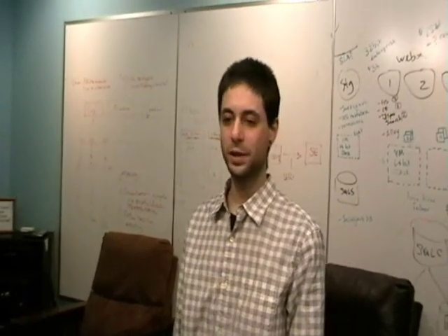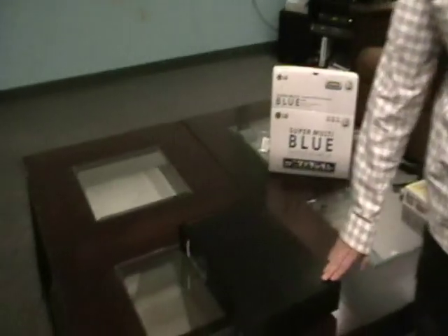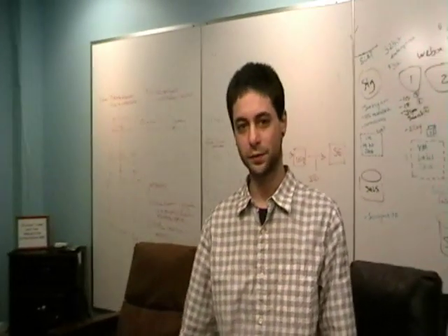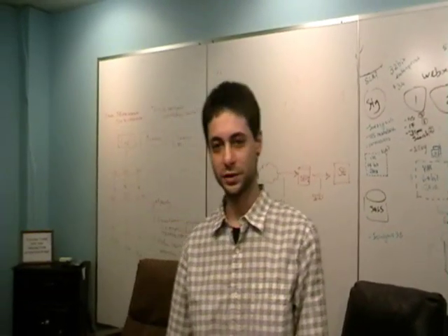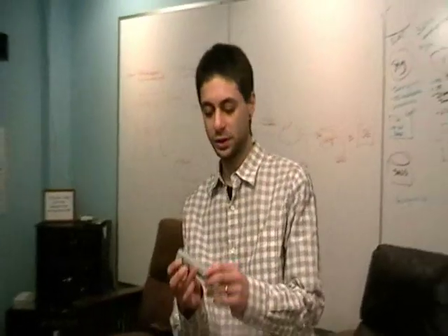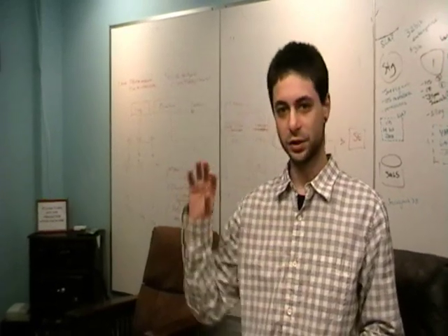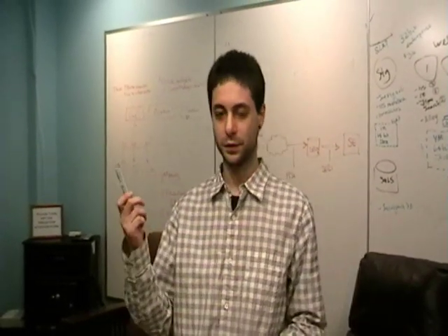Hi, I'm Kaplan from the CR4 Blog in Technological, and I've got a brand new Popcorn Hour C200 here. I'm going to show you how to install a Blu-ray drive and a 3.5 inch hard drive. Normally if you install a Blu-ray drive it only has room for a laptop drive, but with a simple modification you can install a desktop hard drive to get a lot more storage space. The only piece you'll need is this U-bracket, which is used for attaching hard drives into optical drive bays like a DVD bay. You can pick this up for a few dollars online.